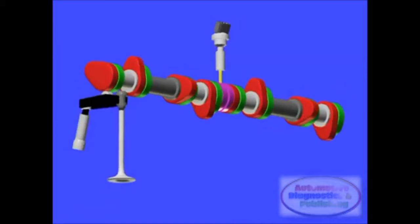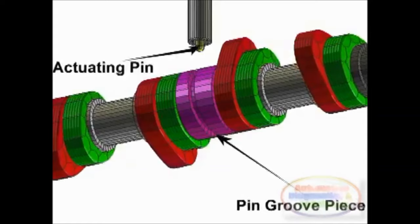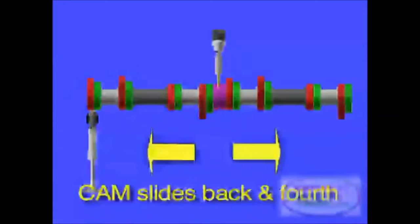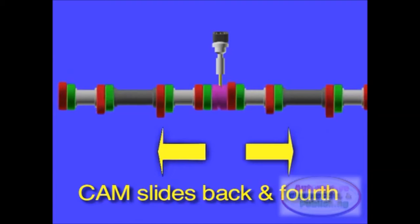This is similar to BMW's Valvetronic system that uses an electric motor, and is discussed elsewhere in this series. But the Camtronic is a two-stage system, rather than continuously variable. The mechanism of Camtronic is pretty simple. The intake camshaft is served with a conventional variable cam phasing actuator at the end of it, as well as the Camtronic variable valve lift electric actuator normally mounted at the top of the head.